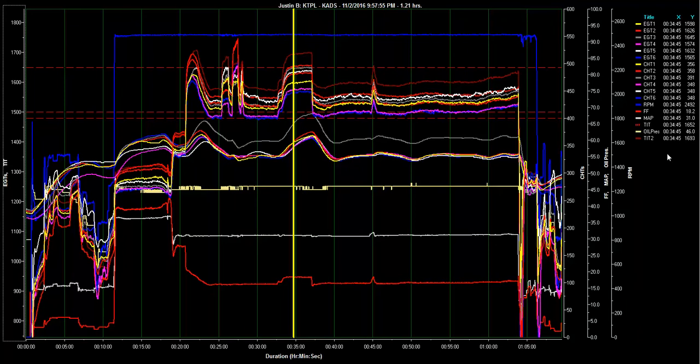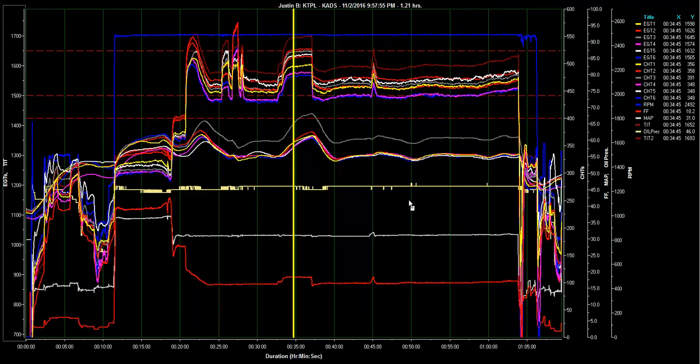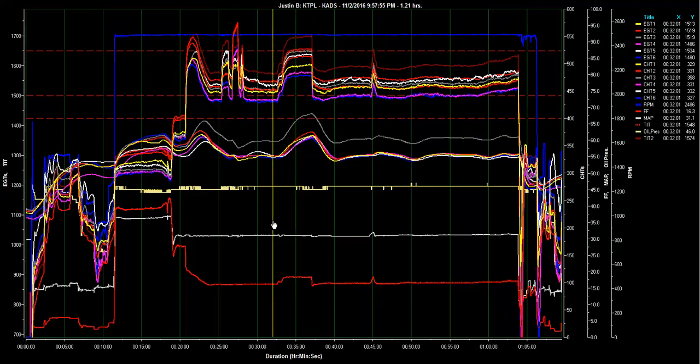Another note right here — this is the oil pressure. We're running at 46 pounds, 46 pounds indicated at the rear of the engine. Generally we find that the oil pressure drops 10 PSI by the time it gets to the front of the engine. The minimum oil pressure is 30 PSI from Continental, and I would like to think that's throughout the whole engine. So you're at the minimum oil pressure for the front of the engine. I would strongly recommend increasing the oil pressure at least one full turn on the regulator — that's about five to eight pounds — and get it into the mid-50s, 53 to 55 in cruise.